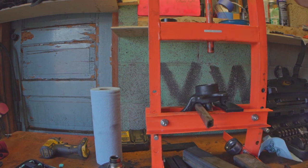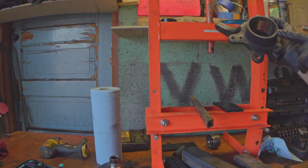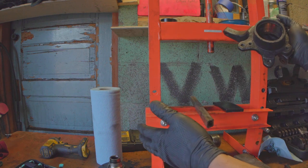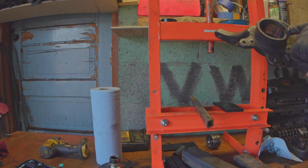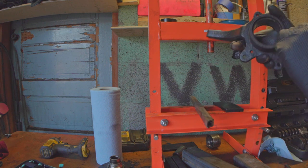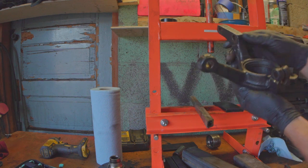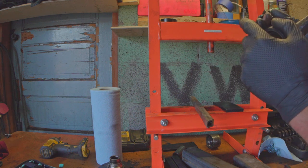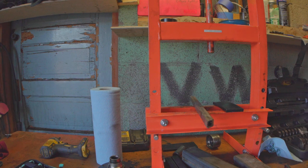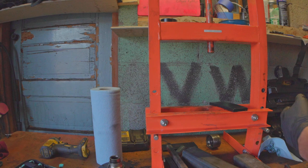Our bearing is out of the knuckle. That's what your knuckle looks like — there are two snap rings, for the record, I didn't realize that. So you could press that out and if you did it tastefully, you could remove the snap ring and press the other thing out the front, which seems easier to fixture — there's this nice face going on. I don't think I did any damage the way I did that. You just kind of need a bunch of hunks of metal, that's pretty much all there is to it.